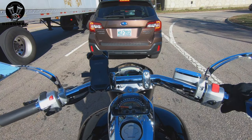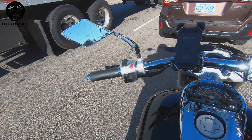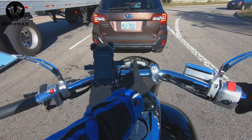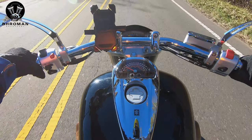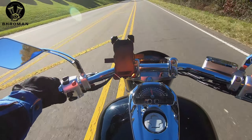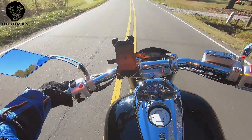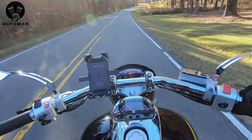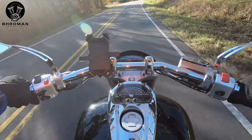This is a very sports-bike-looking fender. Then we come to the front forks — they are inverted front forks. A lot of bikes use inverted forks these days, but not back then; these were only used on sports bikes. For most forks you have a bigger tube and a smaller tube. Look at my 2008 Yamaha Raider — the bigger tube is at the bottom and the smaller tube is on top. Here it's the other way around: bigger tube up on top, smaller one down below. This adds more rigidity to your steering column and makes handling and braking a lot better. It has 310mm dual discs up front with a 4-piston brake caliper, again inspired by the Gixxer 1000.